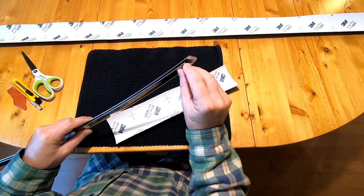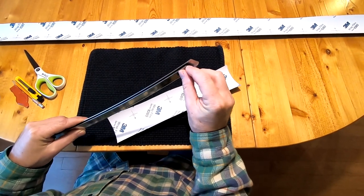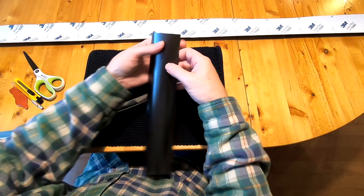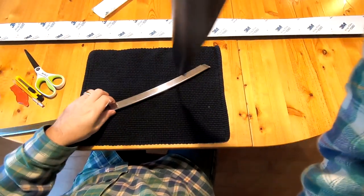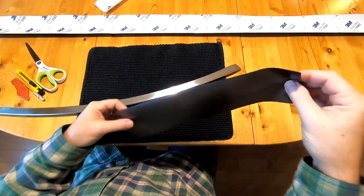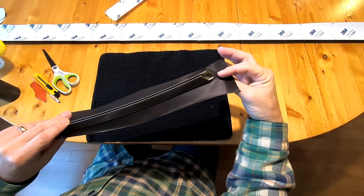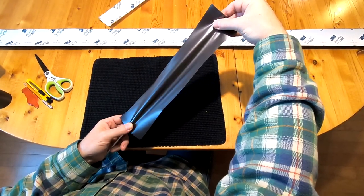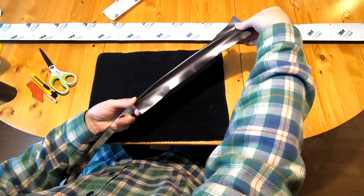Be aware of the wickedly sharp tines on the scallop cut ends — just pay attention to them. Pull back a corner of the wrap backing. The film isn't that thick, but we want to stretch it 3–5% as we lay it down. There's an arc in the bar, and when you pull and lay it down you'll see it lays down really nicely. Keep the two sides from touching while you finish stretching.